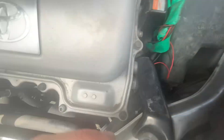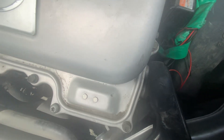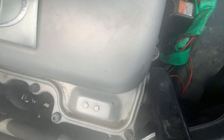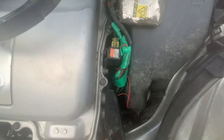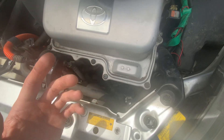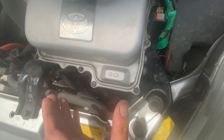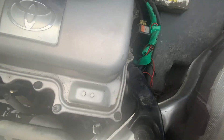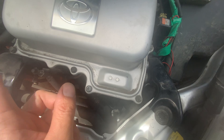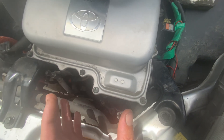This pump has nothing to do with the sounds of the valve. That valve takes hot coolant from the engine and stores it in the storage tank, so that when you go to start your car in the morning, it uses that hot coolant — that valve opens again and it pumps it back into the engine. That's why that coolant storage tank is there.